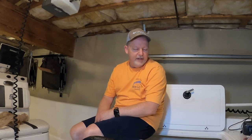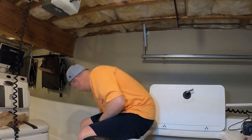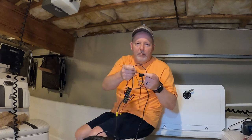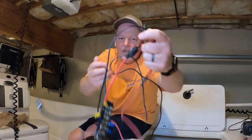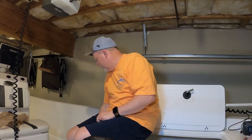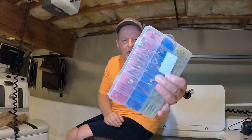My boat really isn't up to code. I've had it for almost 11 years — next month will be 11 years. The boat wasn't rigged out like it should have been, it wasn't professionally rigged. The wiring I had was just fuse blocks, and this is not marine wire. The trolling motor wire is a number 10, and none of the splices were marine grade — they didn't have heat shrink tubing on them or anything like they should.